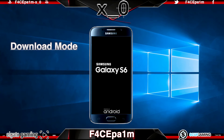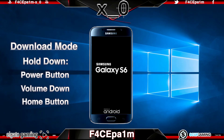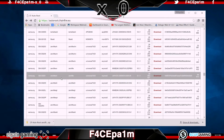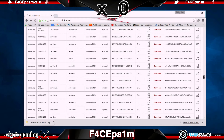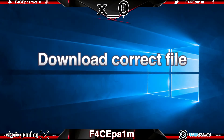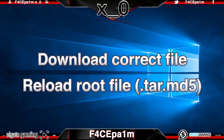But don't panic, all is still good. Just hold down the volume button, power and home buttons again until the phone goes back into download mode. Then head back to the autoroot.chainfire.eu site and download another Autoroot file, this time checking that it is 100% the correct file. Keep in mind there will be different files for the Samsung S6 and the Samsung S6 Edge. You can see the SMG920i and the SMG925i — both are Australian S6s but the 925i is for the S6 Edge. Check your device settings for the exact model number, download the correct file, extract it, and in Odin click the AP box again and choose the new .tar.md5 Autoroot file.